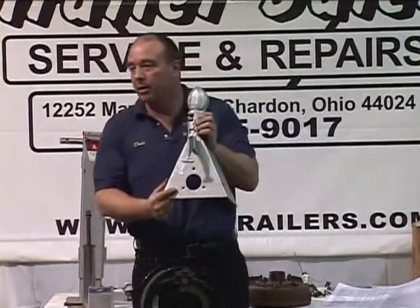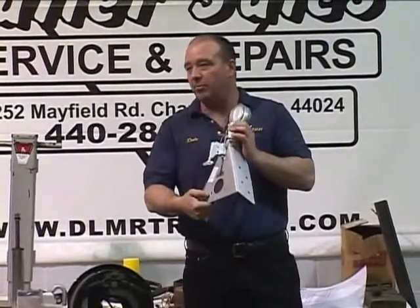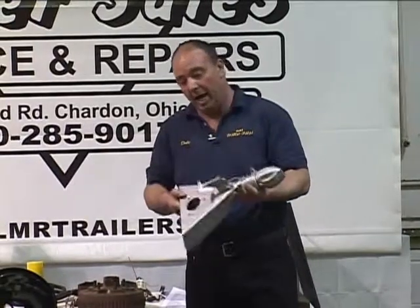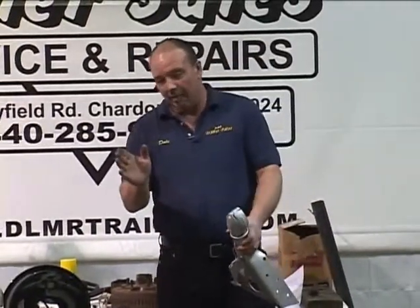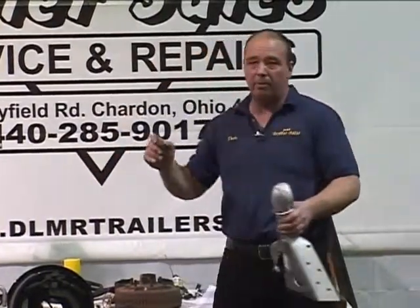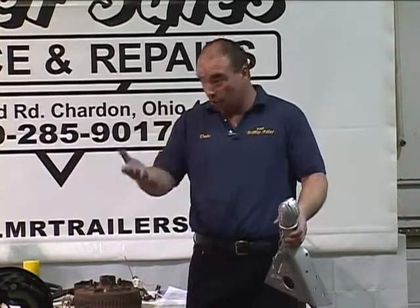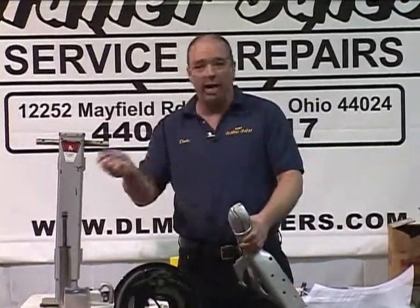That's pretty much your coupler. It's very rare that you'll see the lift-tongue style coupler; this is your most common. If you have a gooseneck, lubricate that slide plate and your lock arm — those are basically the same points. If you don't lubricate it, you'll be heating them up with a torch and spending a lot of time freeing them up. Ball grease — how many guys use ball grease? Use it. I don't care if it's ball grease or lithium grease — use it. We replace couplers that wear out, and they wear holes through the socket or wear your ball out. You'll be hearing clunking and banging, and there's no grease in there. They will wear out.